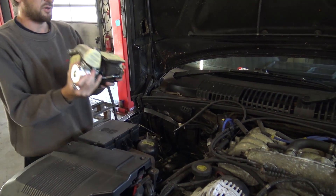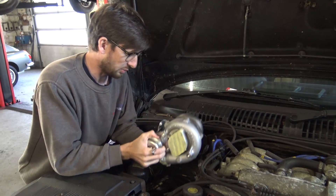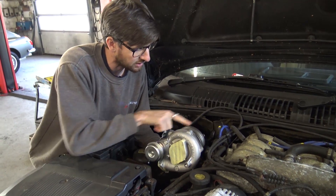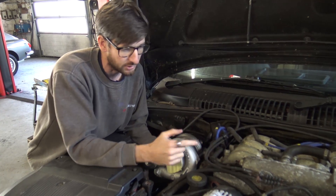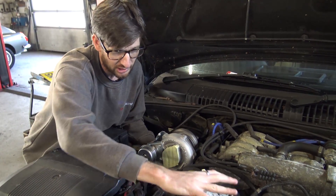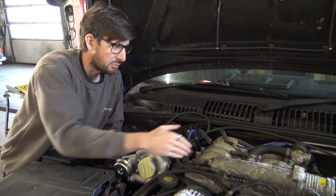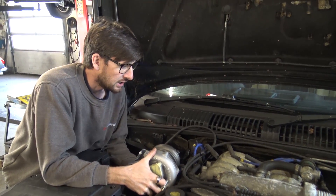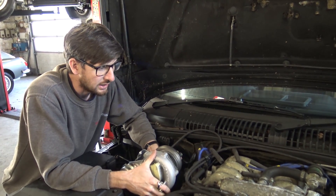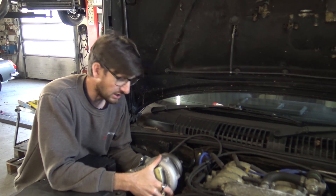Secondly, when you weigh up the options of twin turbing one of these engines in this engine bay, there is very little space this side for all the pipework and everything. So if this turbo is mounted this way round, granted we could clock this so the outlet is pointing that way and then take pipework — we could bend it this way and then come forward and then run past the radiators. So this is actually all consumed space. That doesn't really work. Could clock it over so it points this way and put a GEMS plenum on here and then run the pipework round the back of it. That would work, but don't really want to — trying to do this as something that people can install and almost purchase as a kit really. And changing a plenum and an inlet manifold is a lot of work. Although obviously injectors are going to need to be discussed later. So there's not really a lot of space this side.